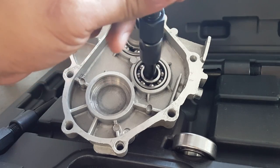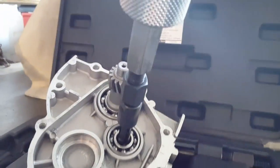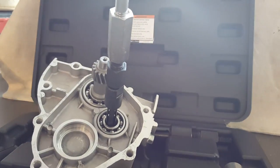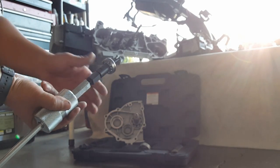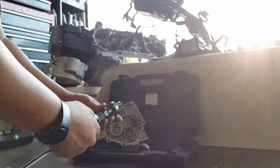It's different sizes for different ones. You could probably use the medium one for this one too, but I prefer to use the right one. So you go ahead and give it a good screw in there, and what I'm doing is screwing the hammer side into the full unit — the receptor. All right, so here we go. I'm going to swing this hammer here, going backwards so you can see a little more. This is how you use this sliding tool to hammer it out. And that's how it pops right out — it didn't damage anything. What a lot of people do is try to pry on the aluminum, but when you pick on the aluminum you're eventually going to shave off something or puncture something, and you don't want that. These ball bearings are supposed to be left really smooth and intact, so if you have a hard time, just get one of these puller removers — it makes the job so much easier.